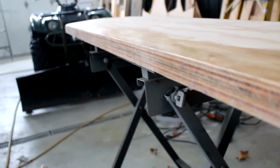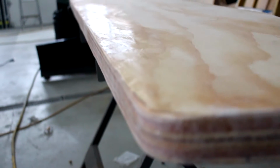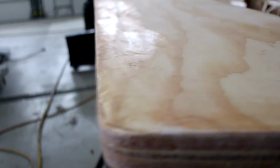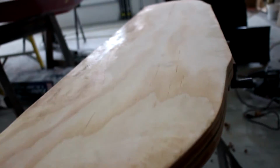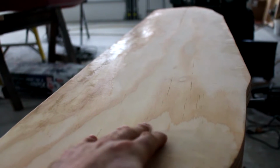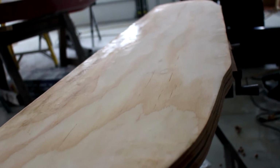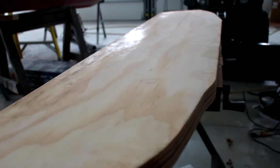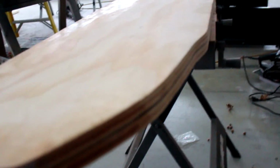really be sure it's sealed before I fill that void with thickened resin and tab this all in after it's on there. What I'm going to do now is just a bit of sanding to make sure we're all real prepped. This is the back side that's got to be laminated to the boat there. And I want it to just be perfect, so we'll prep it and probably on the front round the edge a little bit so that when I laminate it in, that goes easier.